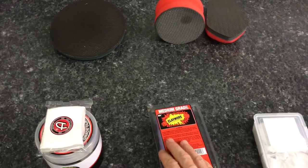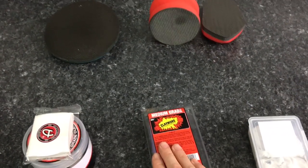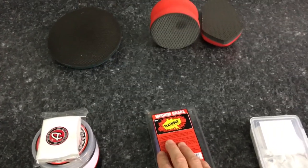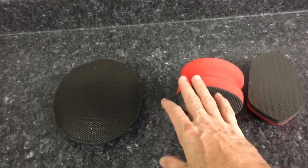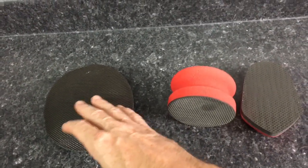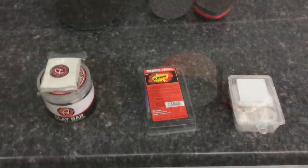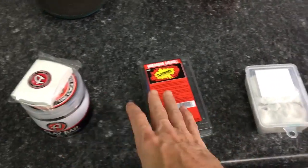It's really hard to determine how many uses you can get out of these — that all depends on the condition of the car. Maybe three to six uses from a clay bar. You can also cut it in half or in fourths. When it comes to the pad itself, that is also dependent on how you store it. I like to rinse mine and when it's completely dry, put it face up in a plastic container. Clay bars can go back in the container you purchased them in.